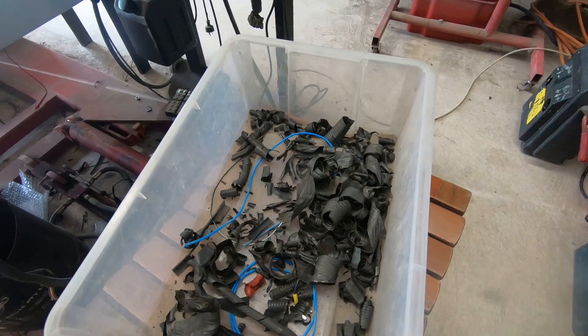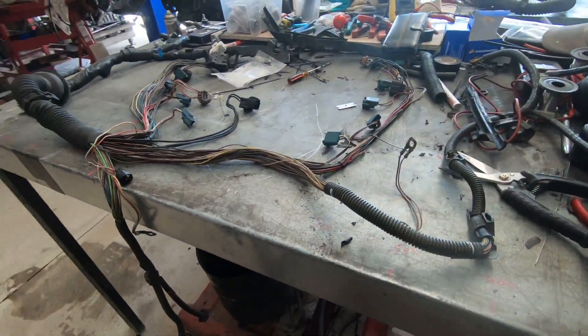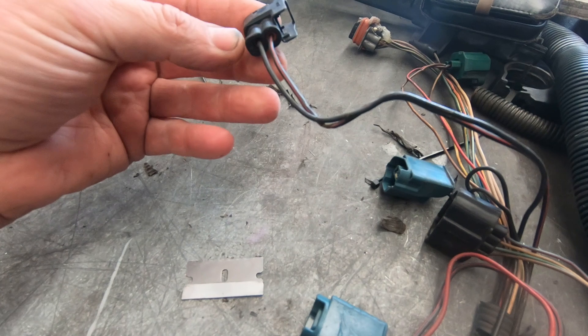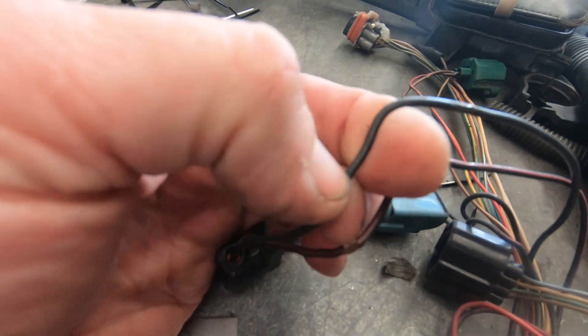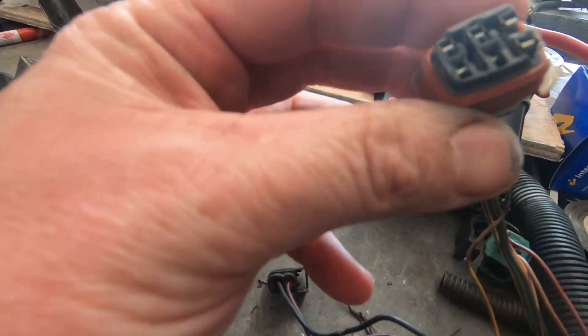I've already made a crank loom down the front for it, but this loom is going to get a tidy up. We're going to remove the EGR and find some plastics from another job that's using a 20 series loom on an early model engine. I've cleared the tape off and now have a naked loom — the wiring is just falling to bits. Power wires to the coils, temp sensor, all cracking to pieces. The idle speed — it's amazing it even worked.